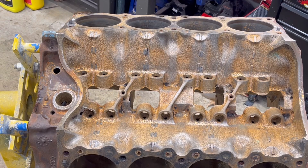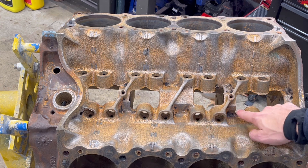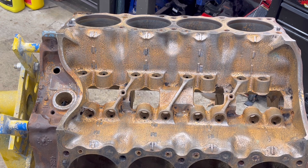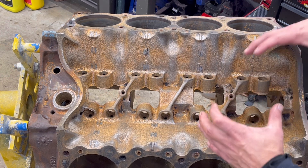Like I said, that was probably one out of 10, 12, 13 times that I scrubbed — I used oven cleaner, full-strength degreaser, pressurized water, bore brushes, steel brushes, plastic brushes, you name it, to get into this thing and really clean it. Did a pretty good job, not too shabby, because as you saw before how nasty and gunky it was. It does look a lot better, but if you look in here, there are still some contaminants. You could probably get in there with smaller brushes or wire wheels and break some free — however, cast iron is porous, and there are still contaminants in here that will start working themselves out.